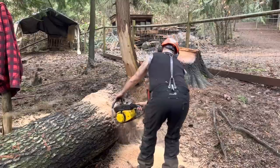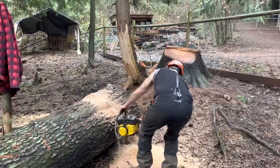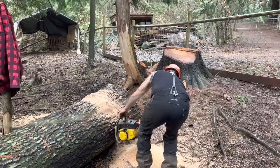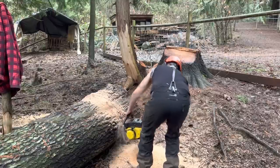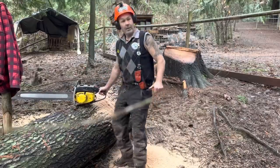Friends, it's important to put some load on the saw when you're tuning as well. You need to load it up a bit. Don't just lay it on there. Put the dogs in, lift up a bit, load the saw so it needs to consume fuel. That will tell you if you're lean or fat.